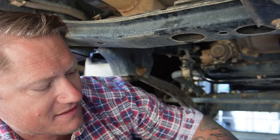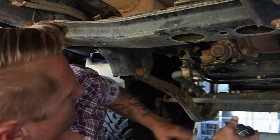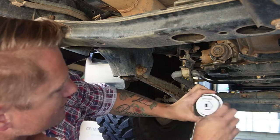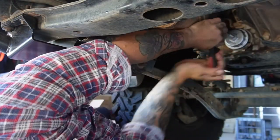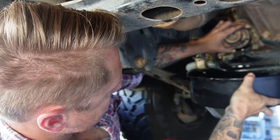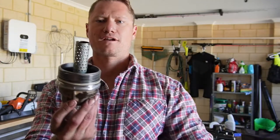This is the RST206 made by Ryco. You need a 3/8 drive for this. You've got the grooves there which go over the corresponding tabs on the cartridge cover itself. We're going to line this up, tuck the 3/8 drive in there and take it out. There will be a bit of oil but not a massive amount. And that's the filter cartridge housing.